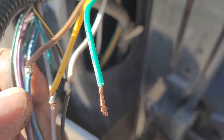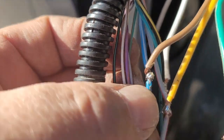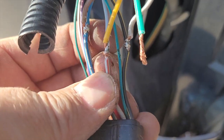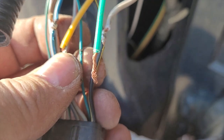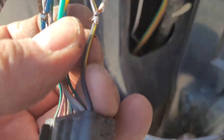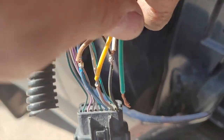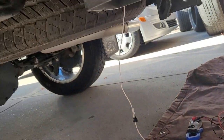Right here I've got the brown wire, which is my running light going to my plug — to the blue wire. The yellow wire goes to the white, or orange-gray — it looks white but it's gray. I've soldered those in. The ground wire is black-yellow, and that one goes back to my plug. The white one is the ground. The only one left is the right signal light — that's going to be my green wire. I'll strip it back, pull it through, and attach it to the plug underneath.